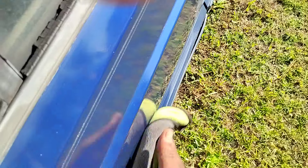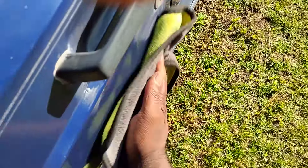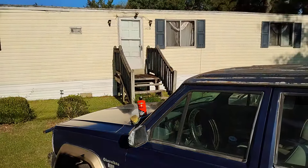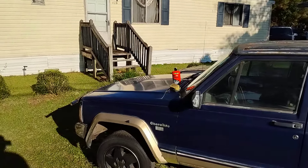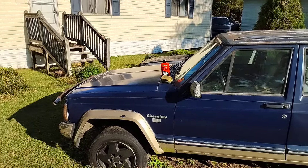It's dry by the time you get it up there — that's the only downside. You need to be able to work with it a little bit longer before taking off scratches and swirls. The work time on it ain't that great — dries up super fast. You need a wax to stay a little wetter than that if you really want good working time. But it does gloss out real good, as you can see. It does a good job on dark paints for glossing out — very, very good in that area. You can see the dual effect: one half of the truck is glossy and the other half is dull. It's doing its trick, actually bringing the truck out.